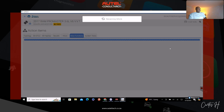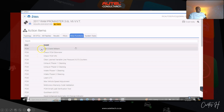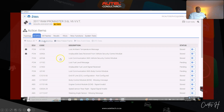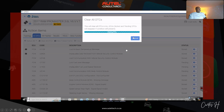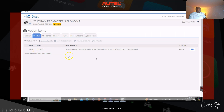My next step is to clear any faults and see what's remaining. If you recall, we had a lot of faults on the system — I'm hoping that programming will be the solution for all those false codes. After clearing, pretty much everything is gone. We have one code, U1710, and my client told me everything was looking good on the dash and the car started perfectly. However, there was another challenge.